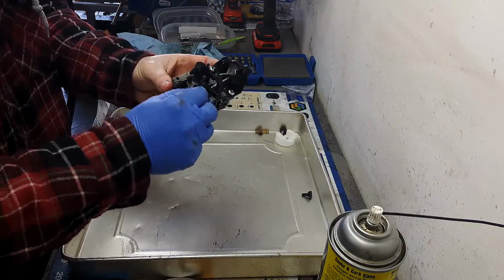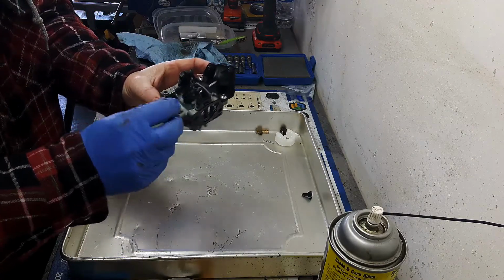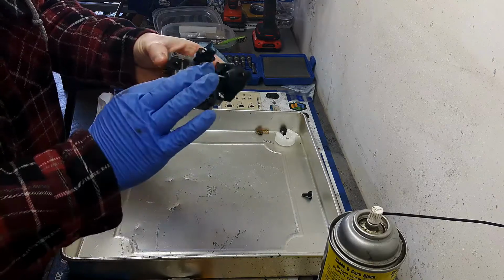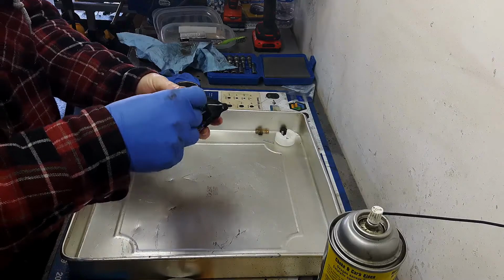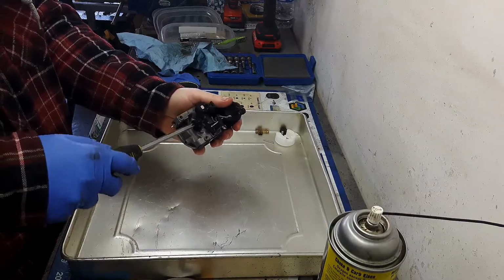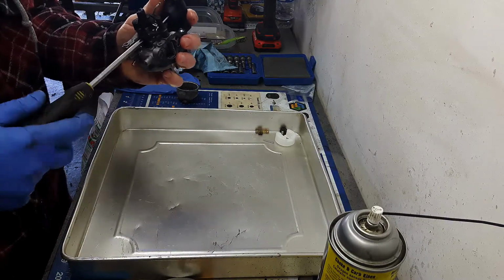So this is just pressure fit. The only thing I do is make sure it's basically the horizontal parts line up with the horizontal part here, front and back. Snap that guy back in. Now this adjusts the idle speed of your lawnmower. Now none of these lawnmowers nowadays actually have an idle speed. You can't actually change the RPM, it's fixed.